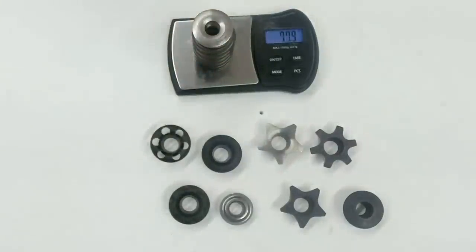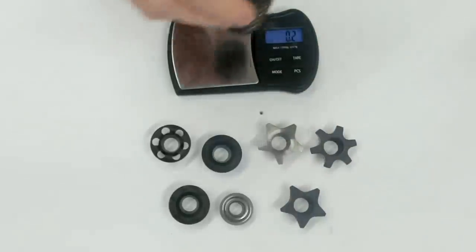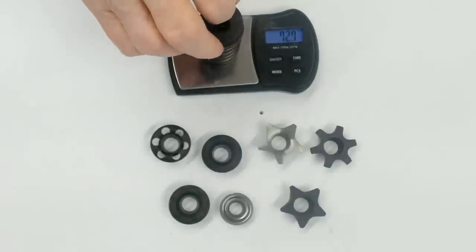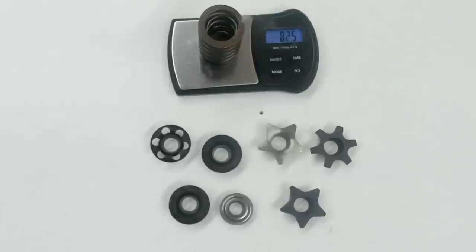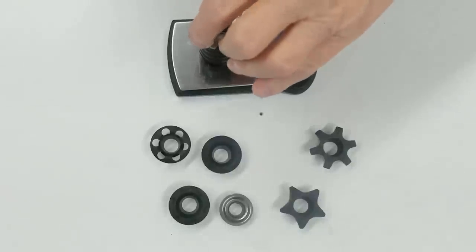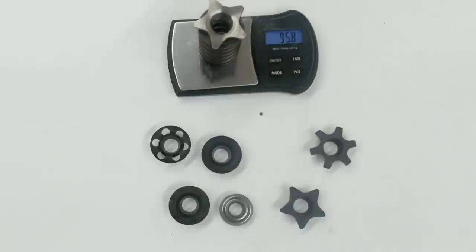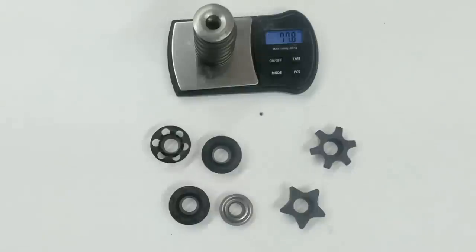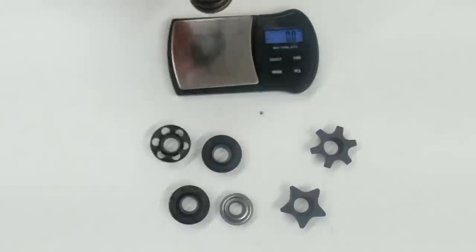Now look, see what that is there? 78 grams. Now let's weigh this one with its steel retainer. 107. Now does there look like there is a weight difference there? But let's say we can engineer some titanium retainers out of some old used ones, right? Now we'd be 95.8. That's compared with 78. Right, so obviously the beehive is the one to go with.